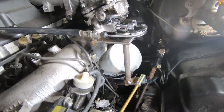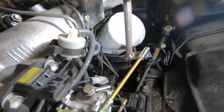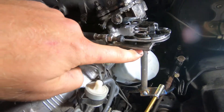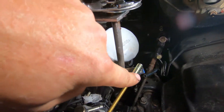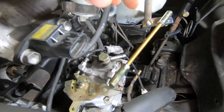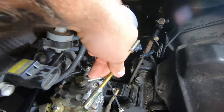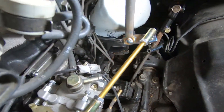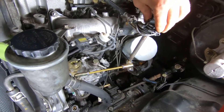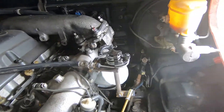Okay, so I finally got the throttle body all hooked up. As you can see, this is what we started with, and I've got this old throttle cable linkage here that I welded to a rod down to here, had a plate come off there, and then I ordered these pieces for this linkage to the injection pump off Amazon. They're just little throttle ball bearing linkage pieces, just to make this bar with some all-thread here. So it's all hooked up — as it turns it pushes the injection pump forward.